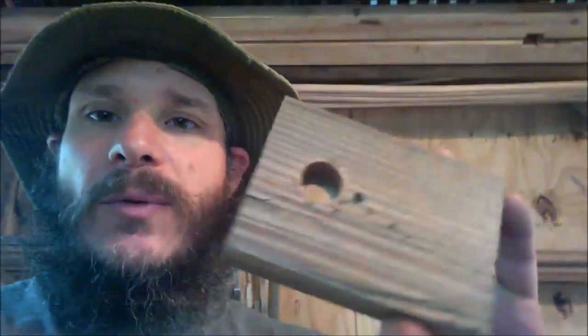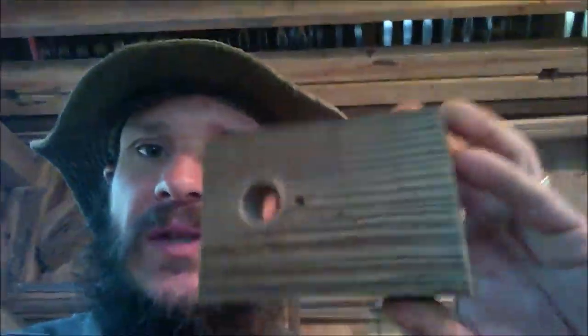When I drilled that out, I ended up making, well, here, I'll show you real quick. I made a drill port so that I didn't have a center hole. I drilled through this block first with the diameter I wanted with the hole saw, and then I put the piece of oak I wanted on the other side of it like this, and then drilled through it. So this hole acted like a pilot hole for the hole saw, so I didn't have to run the center drill bit, and I could just create a plug. Then I drilled it from the opposite direction down through so that it would fit inside the opening. And then I used the pin as basically the original butterfly pivot.